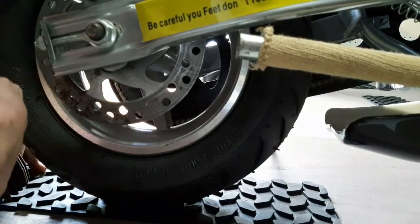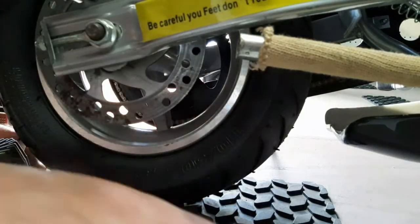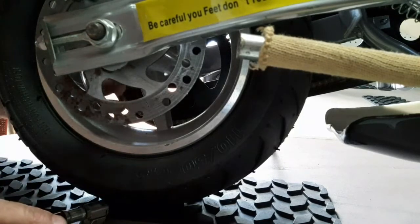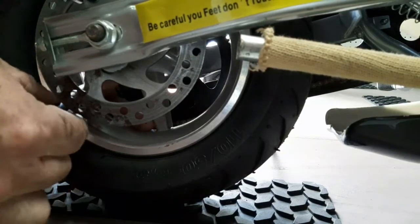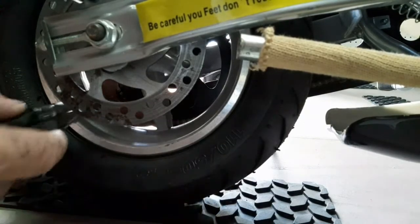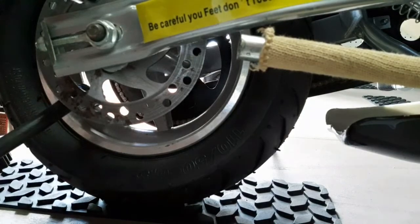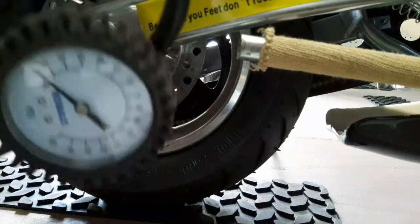take the valves, take the stem cap off. You'll notice this one doesn't have a valve stem remover because you got one on the front. You don't need two. Both the valve stems are the same. All right. What you might have to do, you might have to go around the back side here and push the valve stem down just a little bit to get your air hose on it. Unless, nope, there's no way around it. You're going to have to do it that way. Or depending on what kind of setup you have. Now back once again, if you'll notice, it has no air in it.